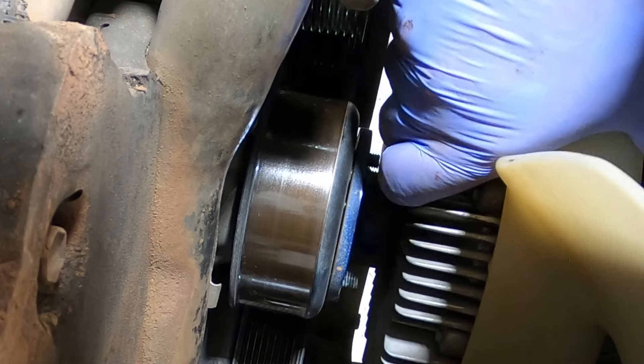There are my two water pumps. I'll prep the new one before installing it. First thing — this hose here needs to be oriented in the right direction. Next, this bolt here is actually captive — it sits behind the fan pulley so you've got to pop it into the new housing before you start. Some of these bolts have some sort of sealant on them as they must go through to the water passages, so I'm going to take a little bit of RTV and coat those threads before running them in.